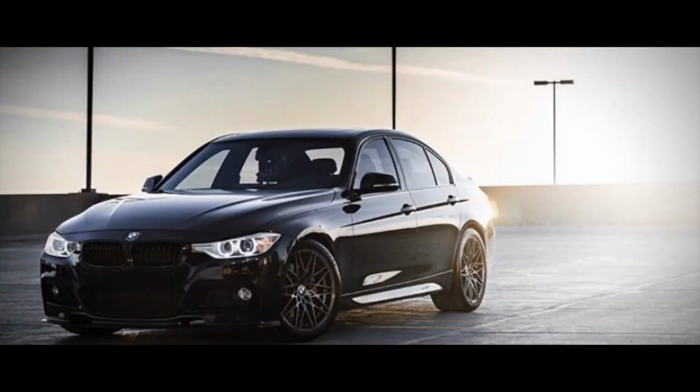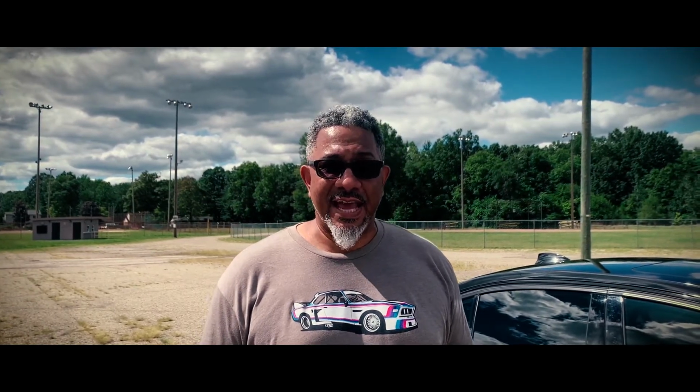So I went down to a 19-inch wheel because I wanted a taller profile on my tires to have a little bit better handling, because the Pirellis were run flats, and I just wanted non-run flat tires to get rid of some of the rough riding components. The car already has enough stiffness in the chassis to make it a little unruly as a daily driver when you're driving around someplace like Detroit with a lot of potholes.